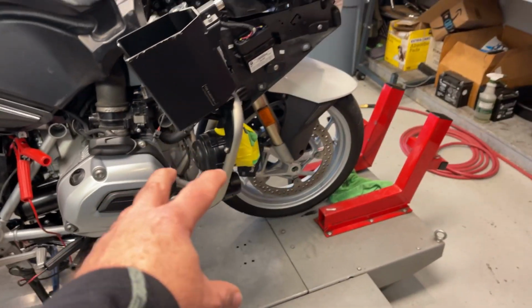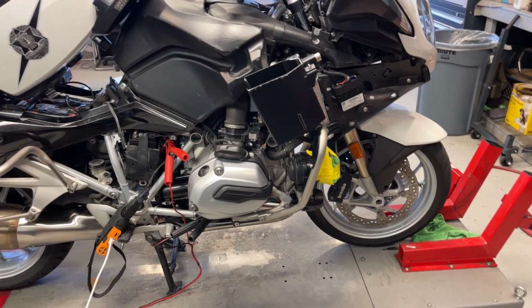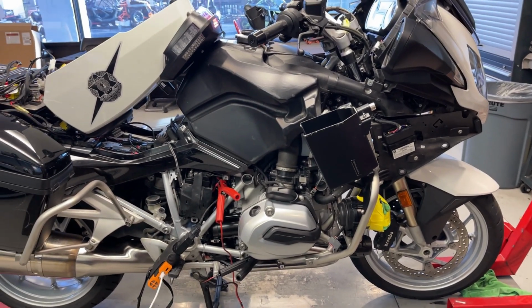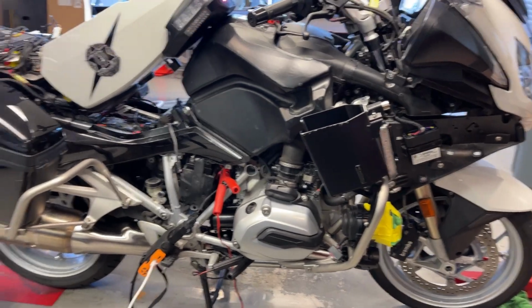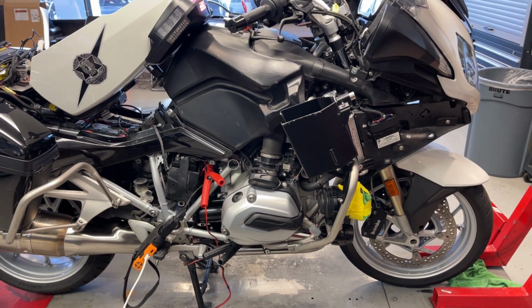This siren, look at all the pins in that thing. The sirens have like a computer in them or something. There's very distinctly a left siren and a right siren, and that is shutting down the LIN bus. The LIN bus, I've told you guys, is a CAN bus helper. Instead of sending signals almost like an AC wire, with a CAN bus high, CAN bus low, and a sinusoidal wave bouncing around, think of the LIN bus as in the old Western days when you had Morse code.